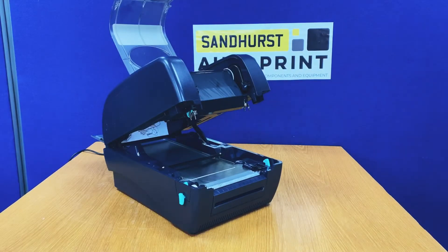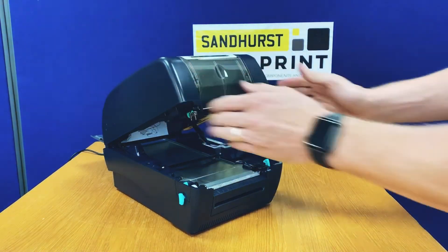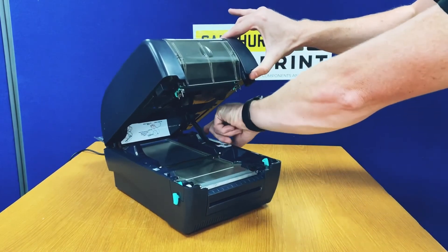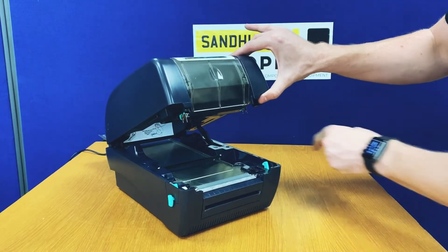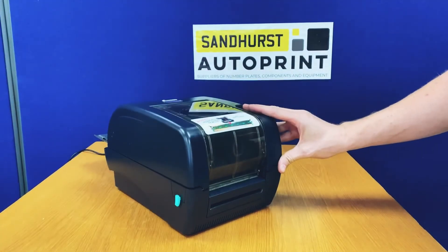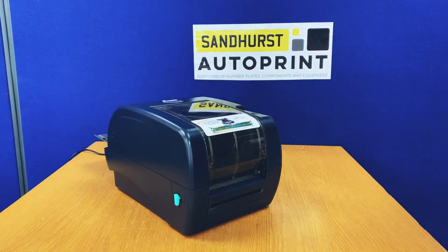It's time to get the printer back into a ready position to start printing. Close and press in on the clear casing, then lift the top section of the printer and push the stand latch forward, located in the top right hand corner. This will allow the casing to close. Please do not let it slam — compress down on both sides gently.